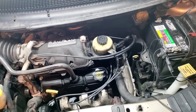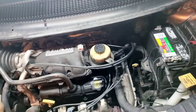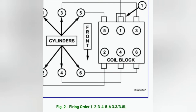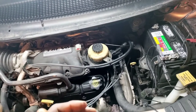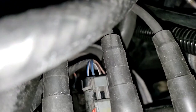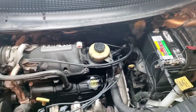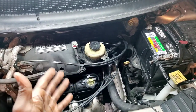The car does sound normal at startup - we're going to hear that shortly. The game plan is to go to the control circuit. I pulled a diagram. We have four wires down here: one that is constantly 12 volts, and then the other three. With this you can actually use a test light and look at the flashes, simply because the control circuit drops the voltage value. So you have one that's constantly 12 volts and then the control for each coil.